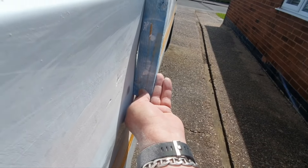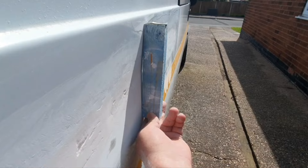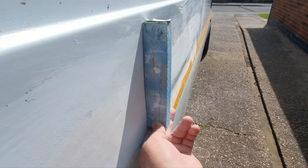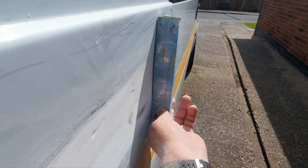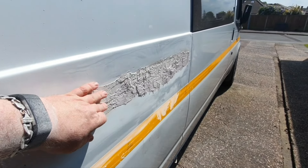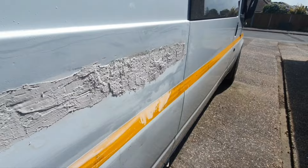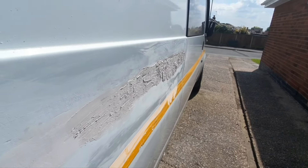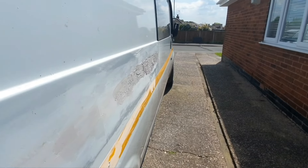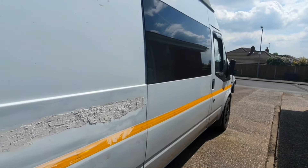Using a piece of wood - as you can see, still quite a bit of filling to do. This end - so it's just really from there. Let's get some mixed up. It's not looking the prettiest but once it hardens I'll smooth that down again. It's a case of just putting less and less in the middle to build up the filler in the scrape, and then using that piece of wood just to make sure there's no gaps. When there's no gaps it's ready - it might take another two or three attempts yet. I've had to park here at the minute because there's been a power cut.